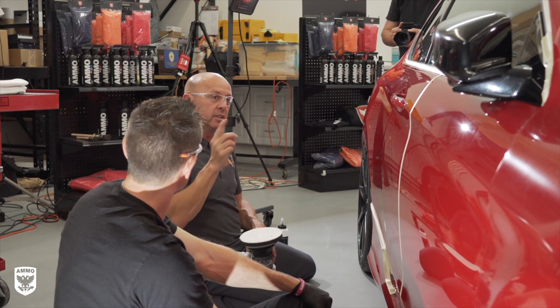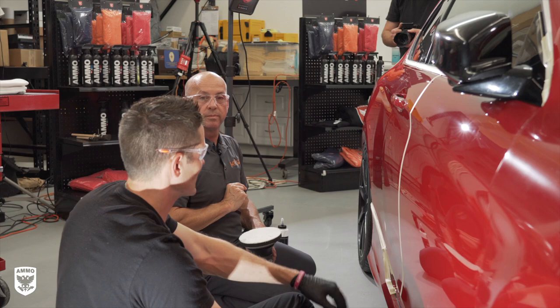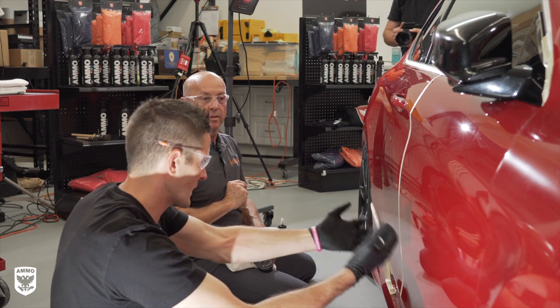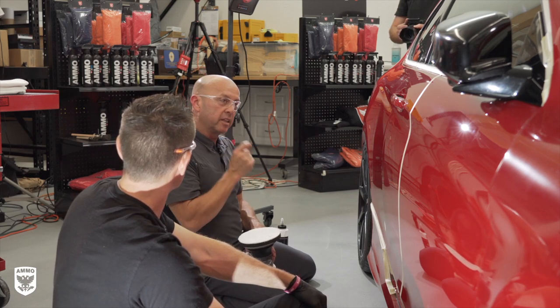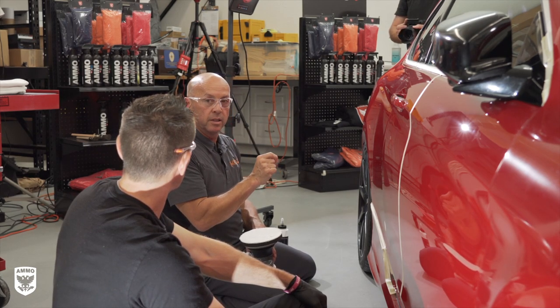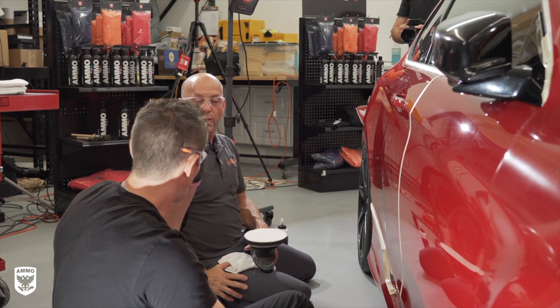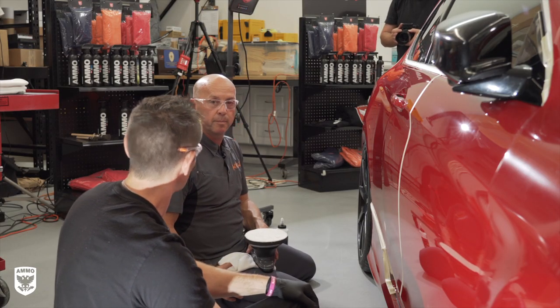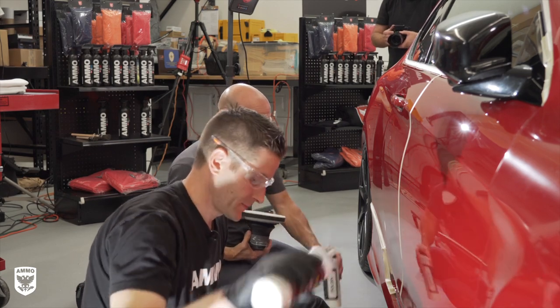It seems like I'm the guy that says don't do anything orthodox. No — I'm saying do everything orthodox, but consider these things we've found out when the paint is not playing normal. When the paint's really soft, or when there's something weird and the paint's telling you something funky, do what the system says to do first. If it's not working, make small incremental adjustments and go to the extremes if you have to — lots of liquid, a little liquid, water — there are all these little variants you can use. Fascinating. All right, back to work.